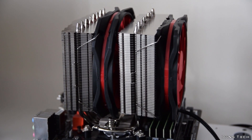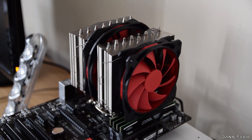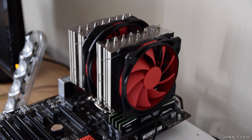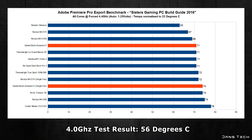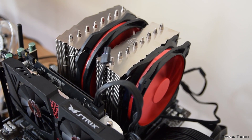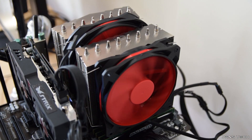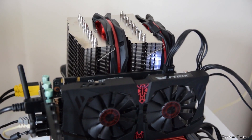Now for performance — as this is a dual tower cooler I decided to run the standard high-performance benchmark, running the Adobe Premiere Pro video render test on the i7-4790k with all cores overclocked to 4.4 gigahertz with automatic voltage. The cooler scored a relatively low temperature, which makes sense for a cooler of this class. I also performed a test at 4 gigahertz for comparison. The noise levels this cooler pushes out are pretty impressive — considering the price this is definitely impressive, as many dual tower coolers prioritize cooling performance over noise levels.